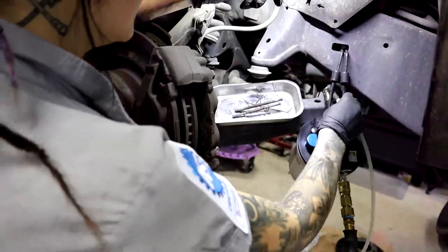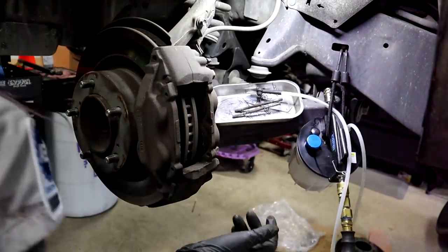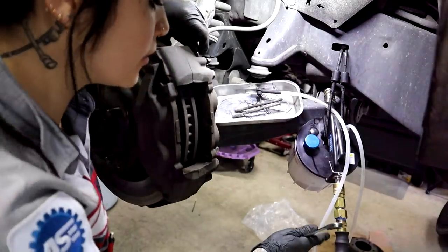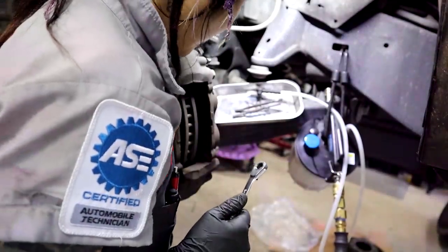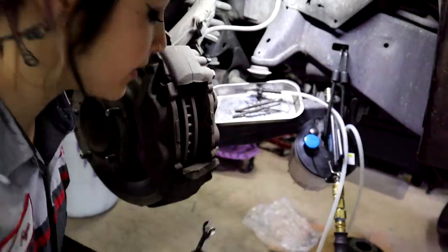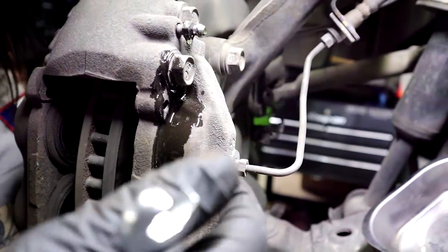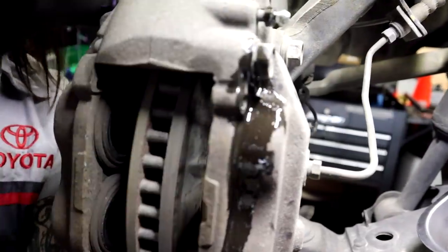Now I'm just clearing the hose so that it doesn't spill any more fluid. You don't want to spill brake fluid anywhere because it will destroy paint, it will destroy anything. One place where I'm okay with letting a little brake fluid drip is out of the bleeder right now, because I'm watching it until it drips fluid. At first when I take the hose off, air bubbles come out — you don't want any air in here, there's supposed to be a sealed hydraulic system. I'm watching it, and I am closing it back up now that it is dripping a steady stream. That way I know there's no air in there. If there is any air, you'll be able to see the bubbles come out. This is a nice steady stream, so now I'm confident. Now I'm just going to tighten this back up.